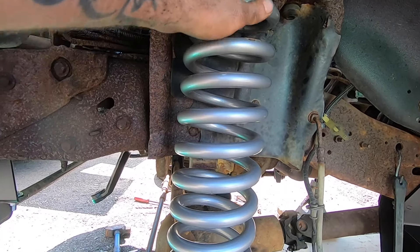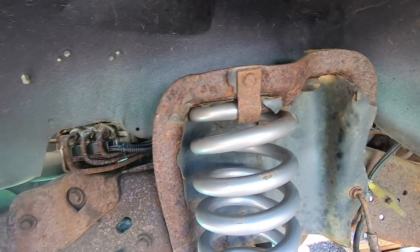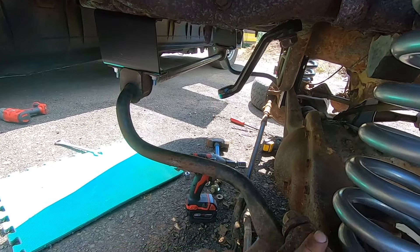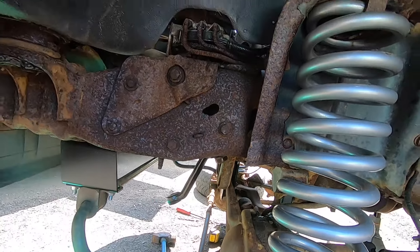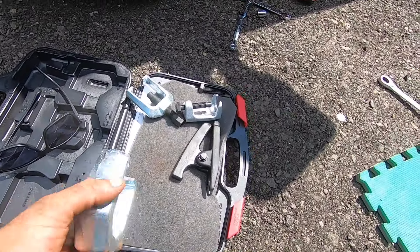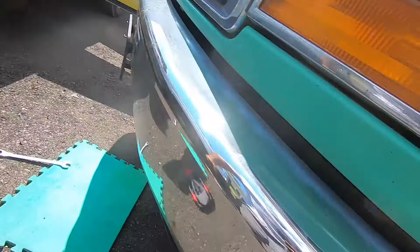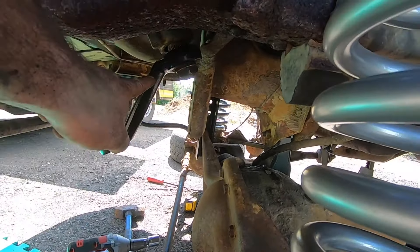Realistically, all I really did was mount up the coil springs with just this one bolt up top with this little U-bracket. I tightened down the sway bar, put these drop bars in, tightened them to the arms. I also pulled the pitman arm off, which was kind of hell. I had to buy this kit because they didn't rent it at Advance — it was $124. Then the kit didn't fit, so I had to grind down these pieces so it would fit in between and actually pull the pitman arm off. That's the old one right there.